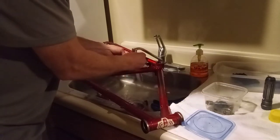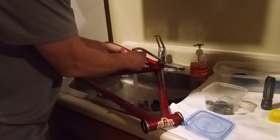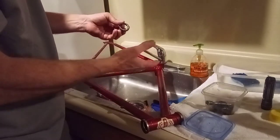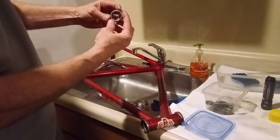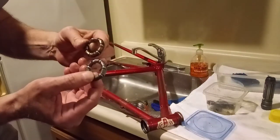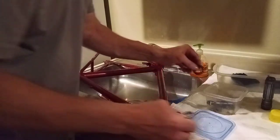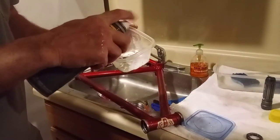Right now with the bicycle part shortage, there are parts that you can salvage and hold on to. Like these will never go back in that track — that track is not going to be rebuilt because too much of it is missing. So I'll clean these bearings and keep them, because whoever knows when I might get another bike where the bearings are ruined. Due to the bicycle parts shortage from COVID, maybe the shop won't have any. This is a perfectly good caged bearing, and you can see how much grease and dirt and grime I've removed from it. Now it's a serviceable part I can put up at the shop and have when I need it. I've got loose bearings in there too — I just leave them to soak.